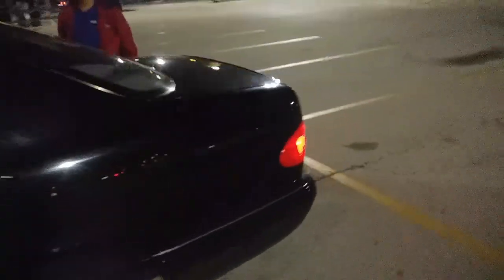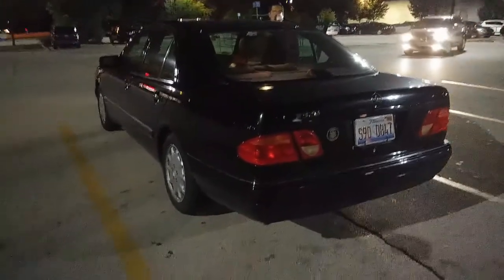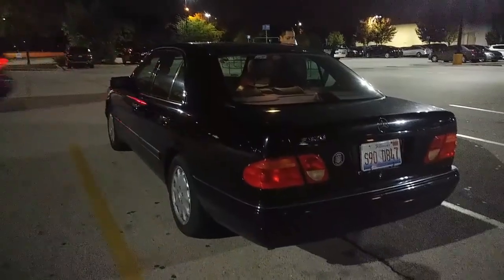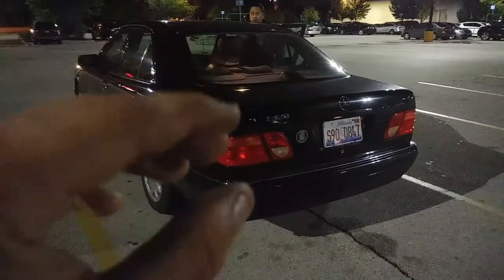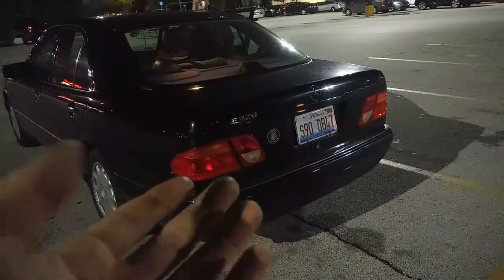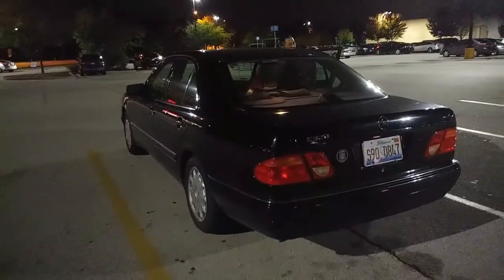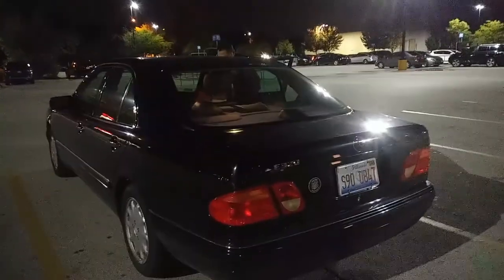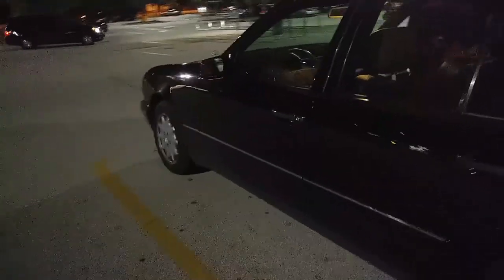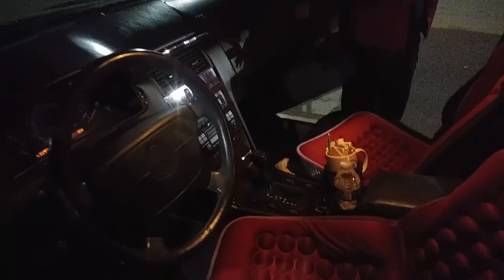This is Miss Kim's W210 Mercedes, just came to Walmart. What I did is that brake light wasn't working so I moved the socket - the contact points weren't making good contact, so I had to bend those metal contacts. Right now it's working. I took it for a test drive over the bumpy road to see if everything stays normal and if the brake light keeps working. So far so good. This thing is really nice - Miss Kim drives this all the time. It's got 93,000 miles, it's flawless, everything is original - sunroof, everything is beautiful.